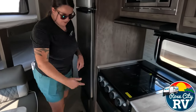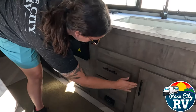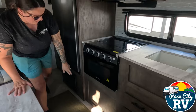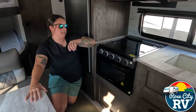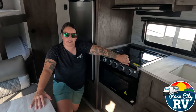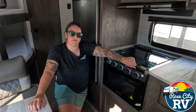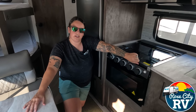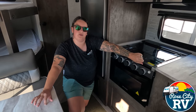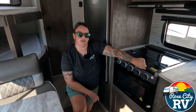I can hear it right underneath here. So I would open these drawers and take a look under there. Because I've been doing this a while, I know these false walls are where they hide things like this, so the water pump is going to be beyond here. That is the only secret to finding your water pump — you literally have to turn it on and listen to it. New RVs are starting to come with schematics, so if you're lucky enough to get one and it's right, it can tell you where the water pump is. But that's not generally the case. So I'm going to grab a screw gun, take this off, and check out the water pump.